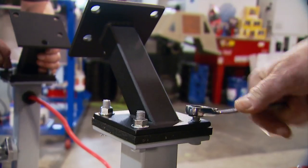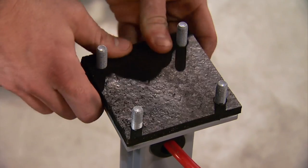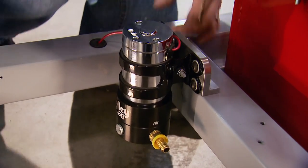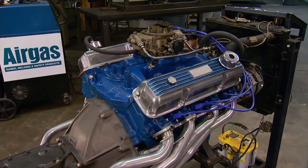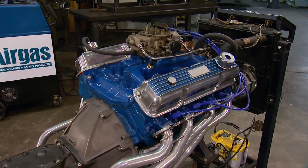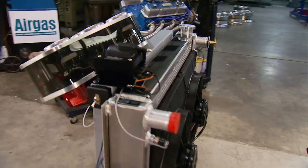Wiring the stand, including the gauges, is the most time-consuming job. Otherwise, it assembles like a big toy on Christmas Day. The true target consumer is the guy who builds engines for a living. You can build the engine right in your shop, put it on the stand, fire it up, check for leaks, do the proper adjustments on the carburetor and valve lash. At that point, you know that motor is exactly what it's supposed to be.